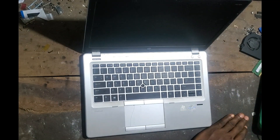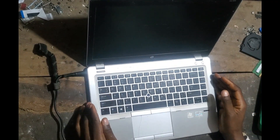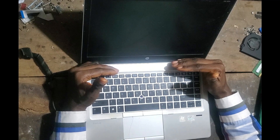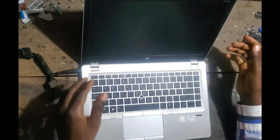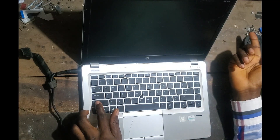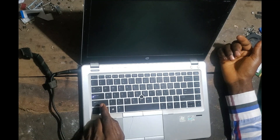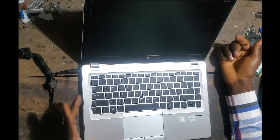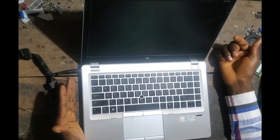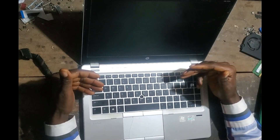So let's see what's going on. It's on, but no display yet. So the caps lock LED blinks. How many blinks do we have here? One, two, three, then it stops. Then it starts again: one, two, three, stop. Another one: one, two, three. So three caps lock blinks.